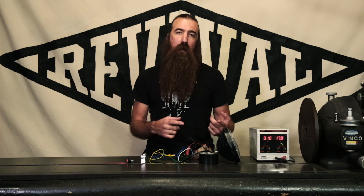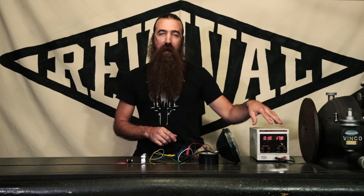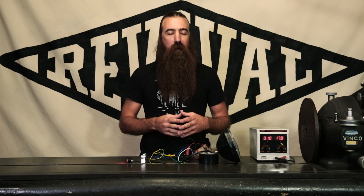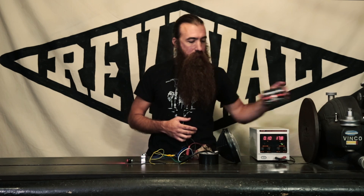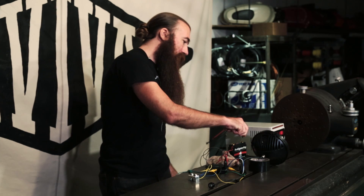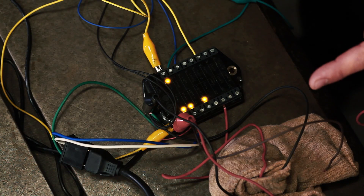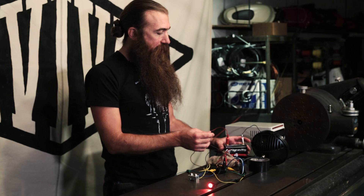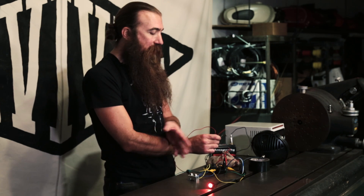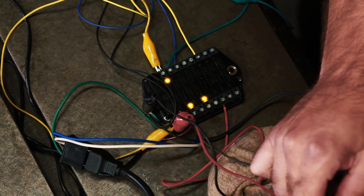One of the other things I wanted to show you is what happens when you do have a short circuit. In order to do that, this power supply can only supply 5 amps. When we give a direct short on the auxiliary output, it will draw 16 amps — way more than 5 — so we're going to switch over to our anti-gravity 4-cell battery for this demonstration. Just disconnect, connect negative to negative and positive to positive, and we're back in business. I've got this wire connected to the auxiliary output, and if I create a direct short to the battery negative, it will cause the auxiliary output to draw more than 16 amps. It will automatically shut down without damaging anything in the system or lighting the wire on fire. Small spark — and there you go, it starts flashing.